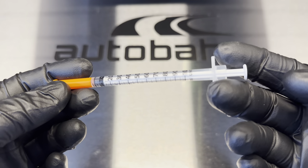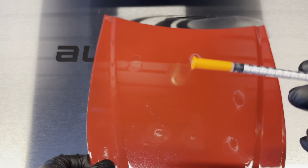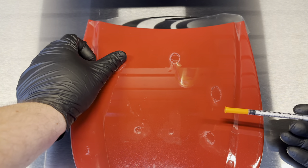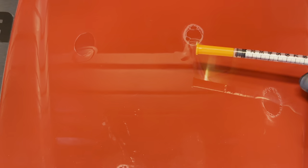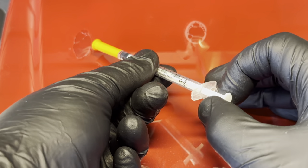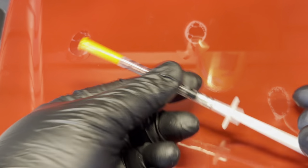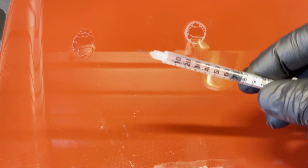I see a lot of newer installers who keep the plunger in the syringe when they're trying to remove moisture pockets — and this is a problem. What happens is they'll take the needle and try to pierce into wherever that moisture pocket is, push it into a bubble, then try to hold it with one hand and pull out to suck out the fluid. Once they stop pulling and release, the air or moisture escapes back in, and I watch the tip of the needle end up scouring the paint or damaging the adhesive side of the film.